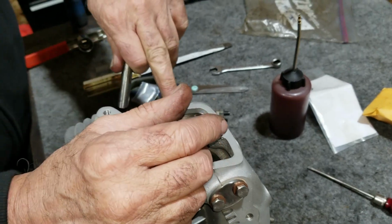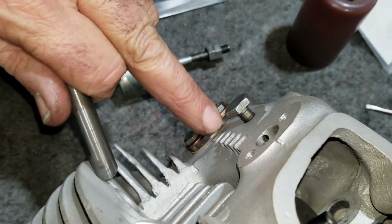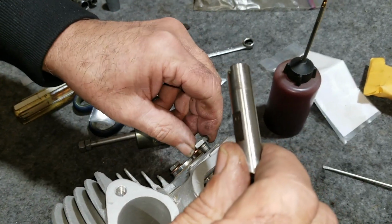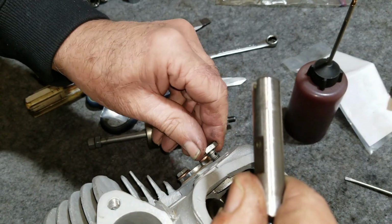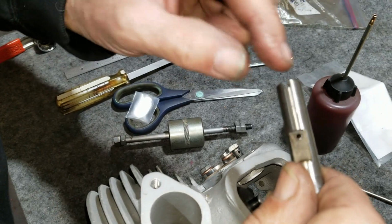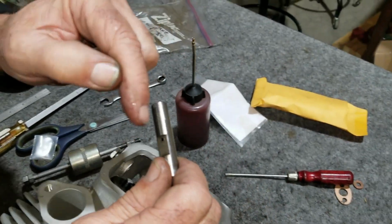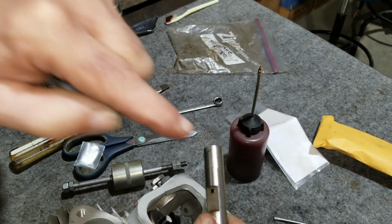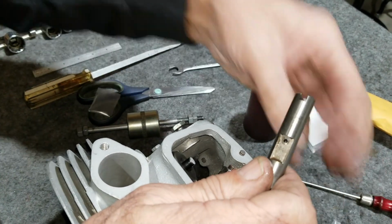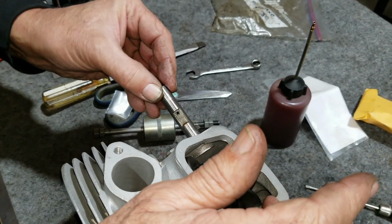And there's an oil hole right here that goes straight through. Your overhead oiler goes through here, and this is a banjo bolt with a hole in it. So oil goes in there, feeds both directions, and goes through this slot. That's why the slot in this cap can't be too deep, because it's got to feed oil through the center and out this hole. And it's got to pressurize this. That's where it gets its running oil.